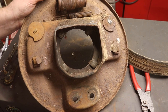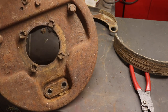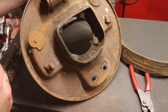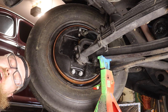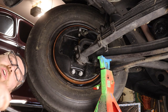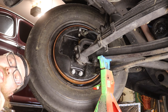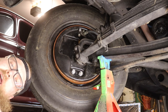Now I took that apart so you can see the upper eccentric. When you spin this bolt around — that's actually very rusty on this backing plate — you're going to be moving this lobe so it pushes the brake shoe further out or further in. So now that you know what's going on, I'm going to show you how to apply that to the car. What we're going to do is break free our two adjusters here on the bottom — just back this nut out just a tad. That's going to allow us to spin the bottom adjusters. The first thing I want to do is just reset it — adjust everything in so there's no contact on the drum at all, so I can start from ground level.